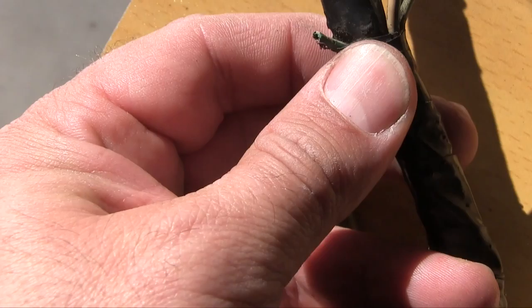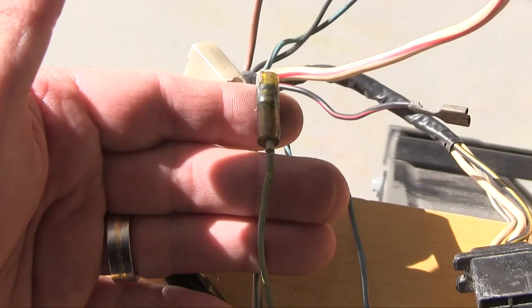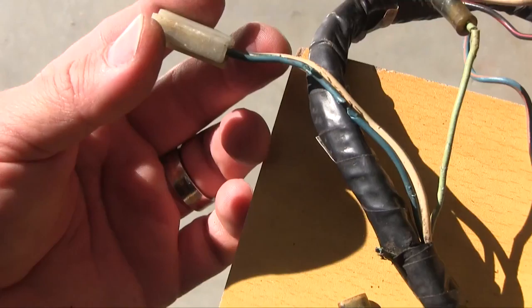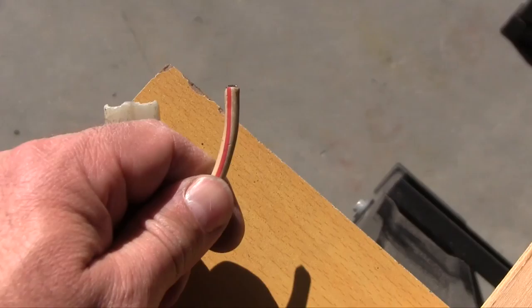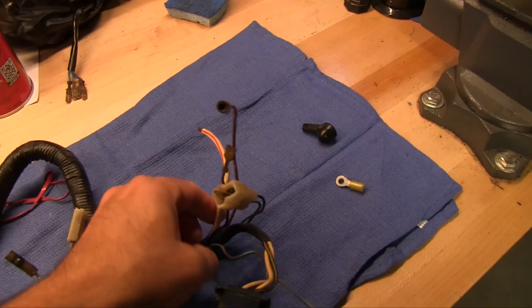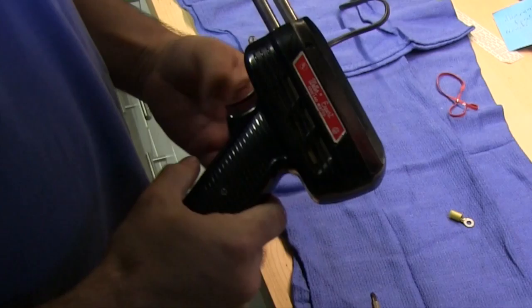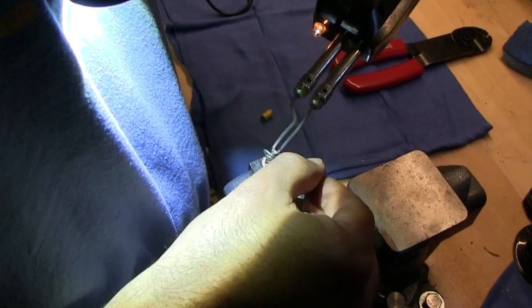Here's what we're down to: I need a blue with orange wire for wherever this goes. I need to fix this little stub for the horn relay. I've got a light green here that's frayed — I want to fix that. The white with blue is okay, but the solid blue is badly frayed. There's also a black I need to fix, a brown with a little fraying, and a power line to fix. This white with red goes to the alternator and needs an eyelet to screw on — I'm going to solder that and give it a new boot. I've got an old Weller Expert soldering gun, classic design, got my tip cleaned off.